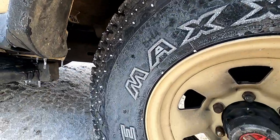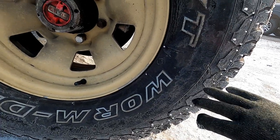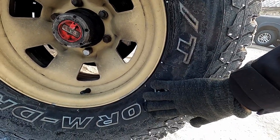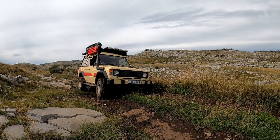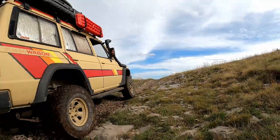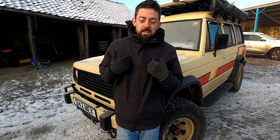Overall a very even wear pattern and I'm impressed with how well these are going so far. No damage on any of the tyres to the sidewalls — all in very good condition — and that's including a lot of jagged rocky terrain way up in the mountains in the Balkans. I'm really impressed with the strength of the sidewalls because we've aired them down to less than 18 PSI. When you get that tyre bulge, the sidewall can become vulnerable, but these haven't had a slice, cut, puncture, or anything. Really impressed with that.